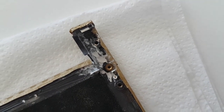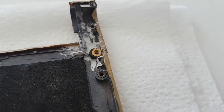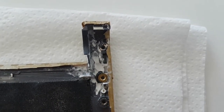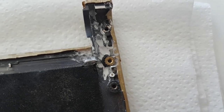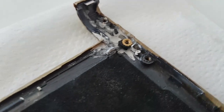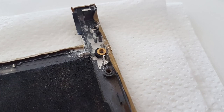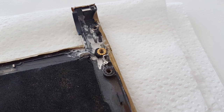Actually, one of the nut inserts was completely missing along with the plastic standoff. Here I already started working on fixing it — I super-glued a nut insert with some plastic in the correct spot. This is a nut insert from another hinge I had laying around. This took some time to align correctly so I did not film that part. The vinyl is still in place and I have to remove it carefully before beginning the next step — this was left intentionally, in no way because I forgot.